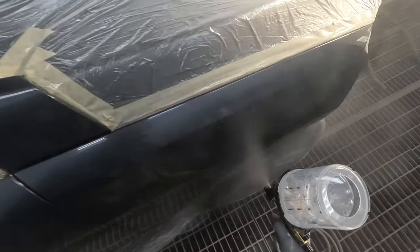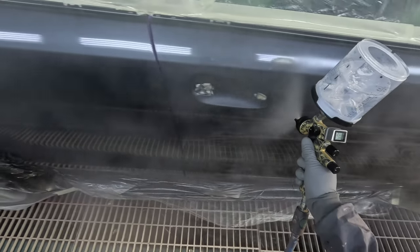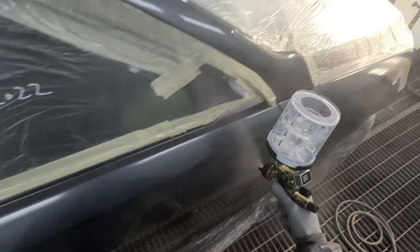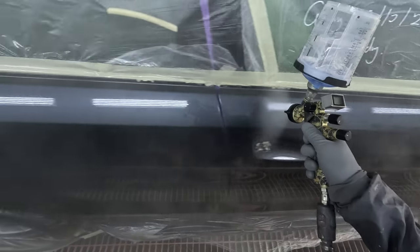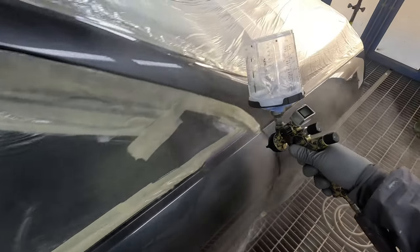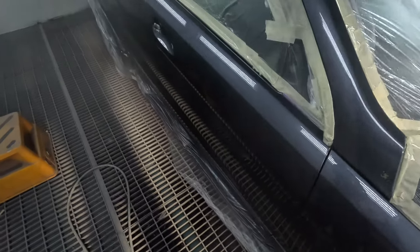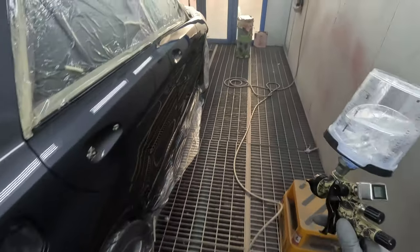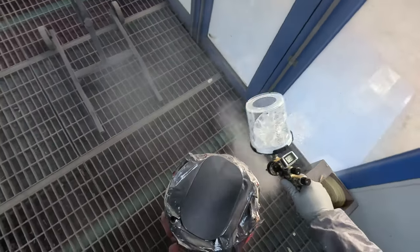One of the things I really love about the premium Standox clear coats is there's no messing around with heating it up. In fact, you really shouldn't heat this in the can — don't ever do that, it'll probably go hard in the pot on you. Even in winter I wouldn't recommend it, and if you did it would only be booth temperature. But out of the box it works well and you can manipulate it to get that finish without having to muck around.